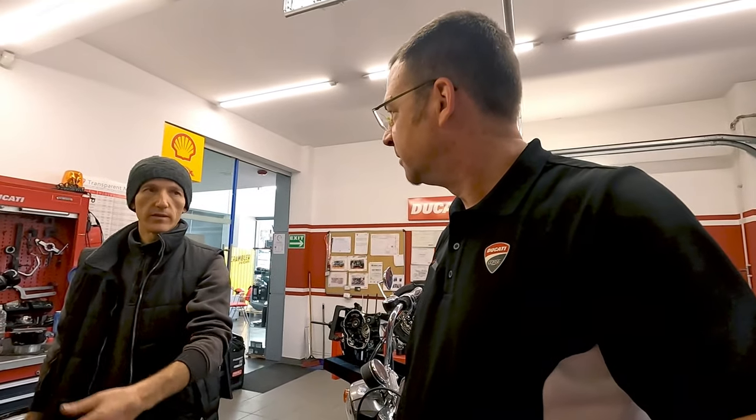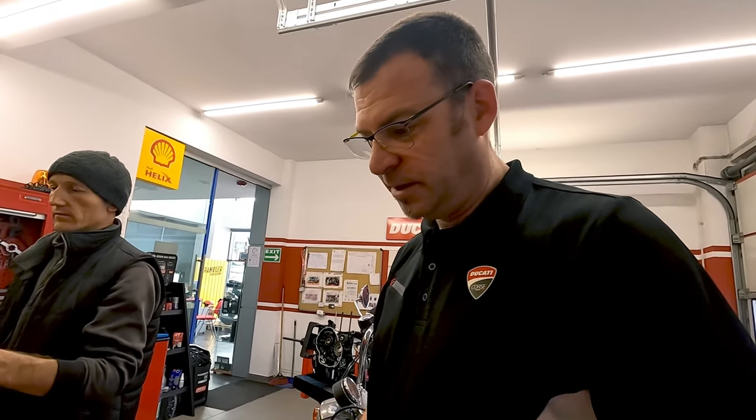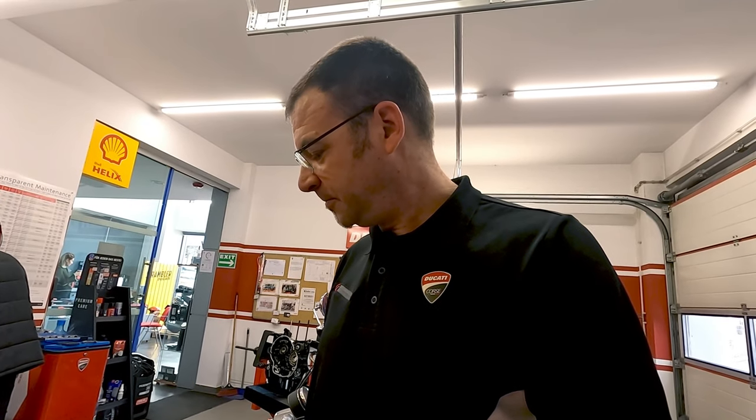It's like a brand new bike — everything is fixed, everything is polished, fantastic, I just love it. Brake pads were changed because they had to be. The brake fluid front and back was checked and was all okay. The fork oil in the front was also not touched because it was all okay and had been done before. Yeah, it's kind of a new bike — I got it in 2018 and I can't wait to ride.